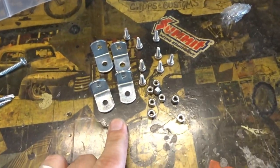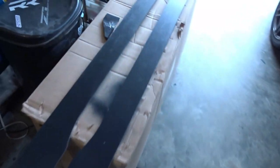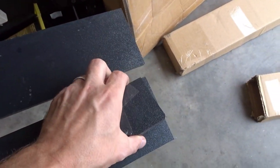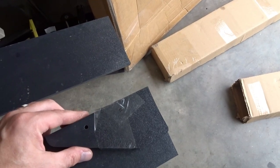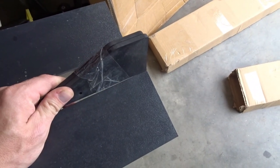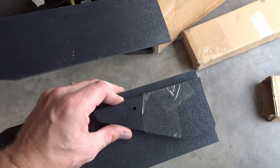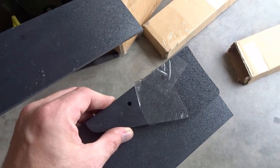Get it in the perfect location rather than pre-drilling holes, holding it up with a box, trying to screw them in from under the car. Get some double-sided tape — that's my recommendation. You get about 14 or 15 self-tappers, giving you about seven per side, which should be plenty especially if you're also using tape. Then there are L brackets with small nuts and bolts to attach the fins. No pre-drilled holes in the splitters themselves, but there are pre-drilled holes in the fins if you chose to get them.